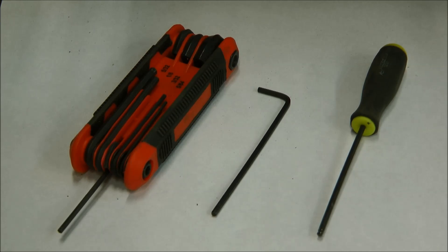Welcome everyone. In today's video we'll demonstrate how to remove radios from your instrument panels. The tool you'll need is a 3/32nd hex head or allen wrench. Those you see here will all perform the job, and 3/32nd is the most common screw head used by most radio manufacturers.